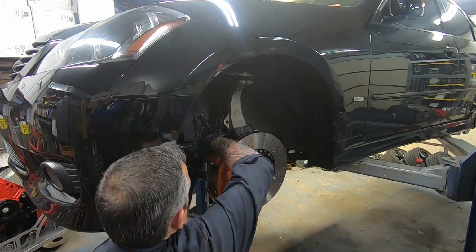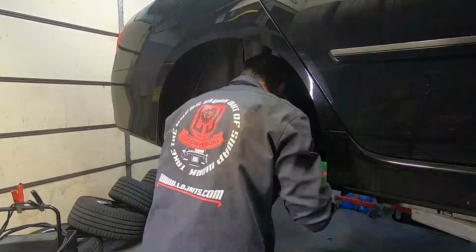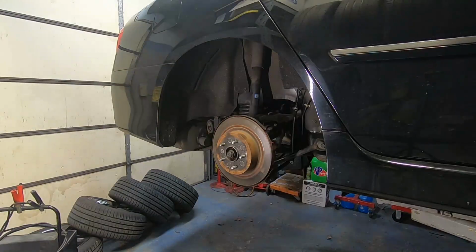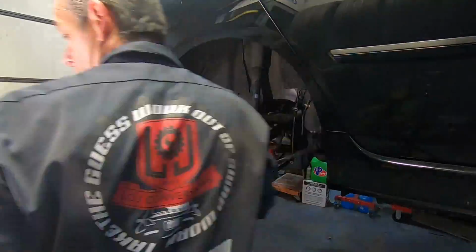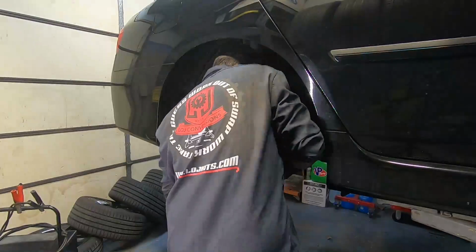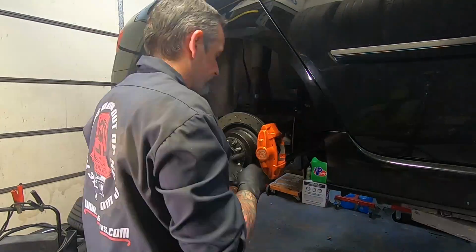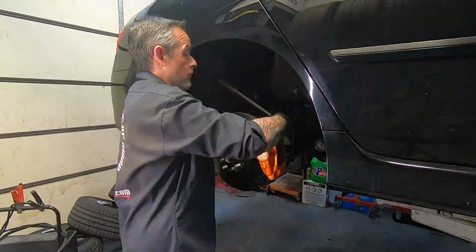And then for the brake pads, I used a Power Stop brake pad that's kind of like their high performance street pad. It's the closest thing you can get to a track pad that still has good characteristics for driving on the street. I do autocross this car on occasion, but primarily it's street use. Sometimes my wife drives it, so I didn't want a crazy aggressive track pad that you need to get a ton of heat into to work. It's got to work for a street car.